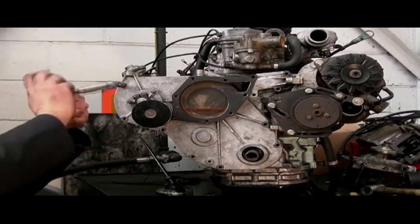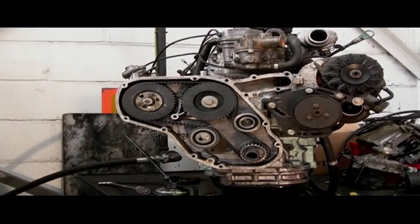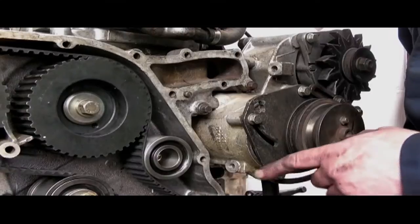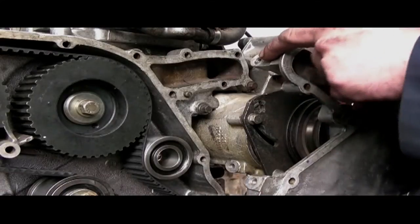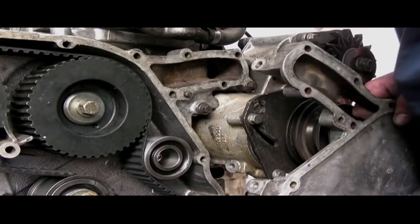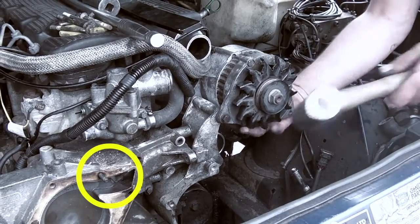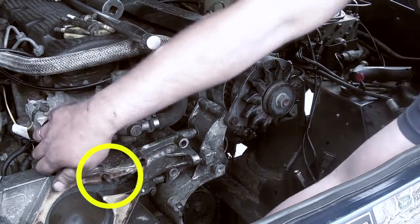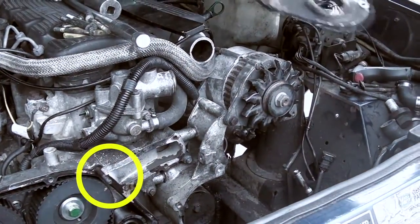So that's off. You'll note I'm using a soft-headed mallet to crack the seal on the gasket — getting that undone without causing any damage. There you have it — the timing belt is now exposed. Coming back to where the bracket holes are: these two correspond with the timing case at the top, which has a step in it. If you happen to have the stud still in the top of the casing, you'll have a problem. The best thing to do is either remove it or drop the bracket out of the way, then slip the timing case front cover off with the studs still in there — it makes it a little more difficult, but it's your choice.